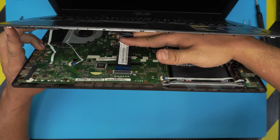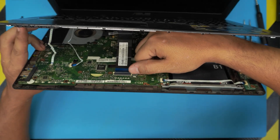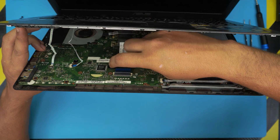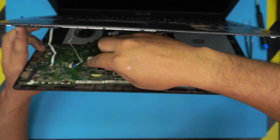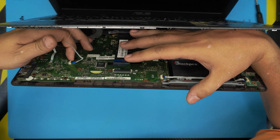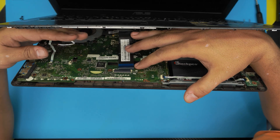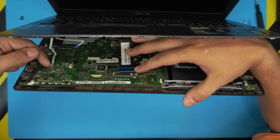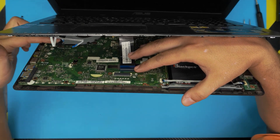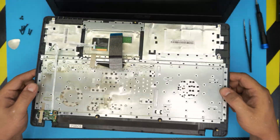Don't yank the palm rest — you need to remove the flex cables for the keyboard, touchpad, and on/off switch. There's a little adhesive at the back, so lift it from the back end first. To disconnect the ribbon cables, pull the white trigger toward the ribbon cable on each side and the cable slides out. For the ZIF connectors, lift the black lock 90 degrees upward, and for the white lock version, lift the white lock to release the cable.